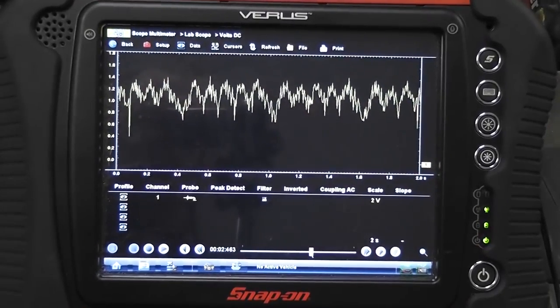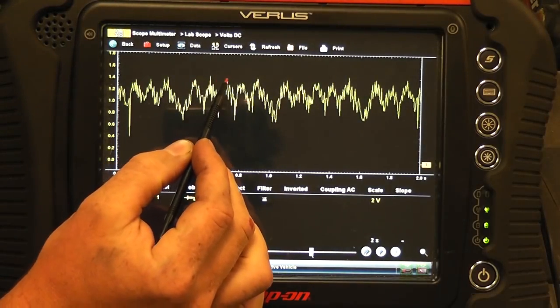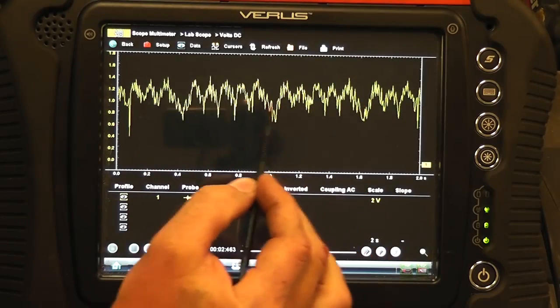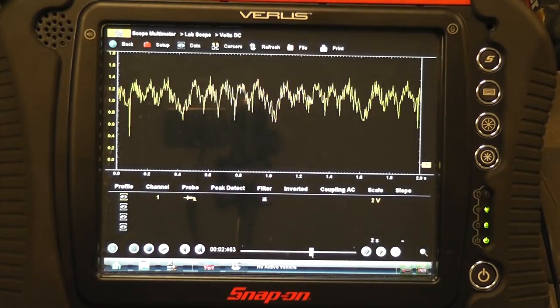What we had before was six even uniform humps on the screen. Counting them: one, two, three, four, five — we're missing one. You have no compression on one cylinder. So that's it. It's a basic test: amp probe to the battery cable. We're just looking at starter current and we're using this to tell us that we have a compression problem, and we never took a spark plug out to put a gauge in to make that measurement. We have a dead hole here for sure. You would not do a tune-up on a car like this, you wouldn't put an injector in it, you wouldn't put a coil in it — you have a compression problem, able to be identified very quickly.